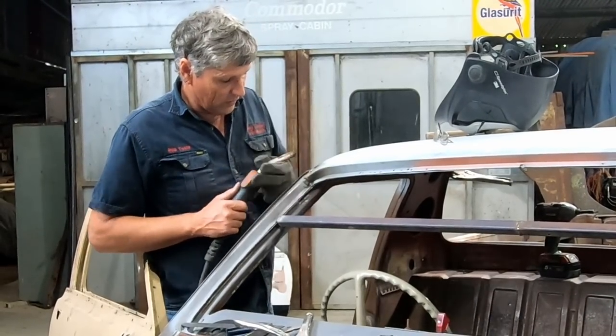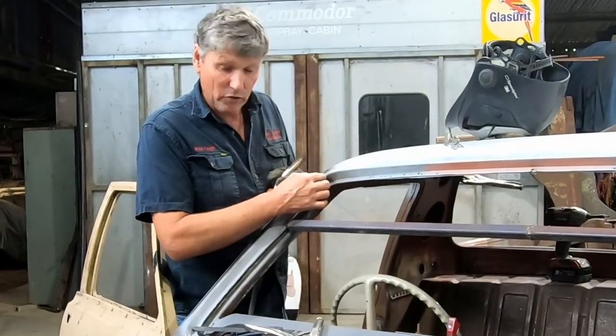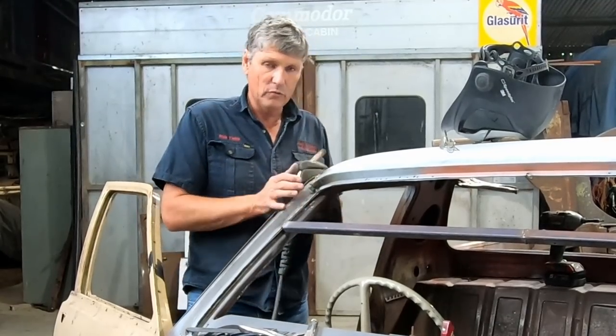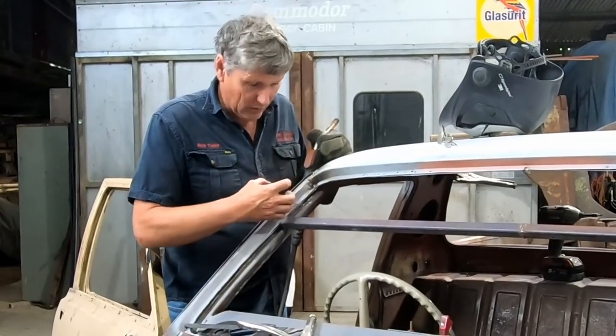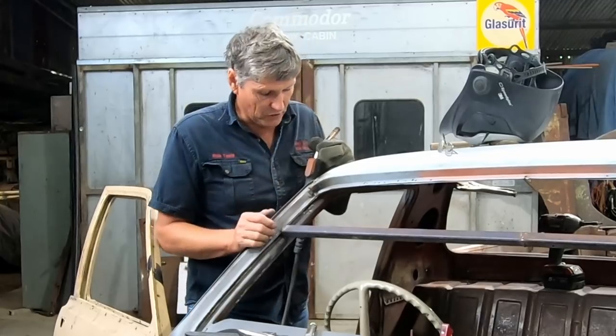And that's the trick. If you put this down and tried welding it as you would welding two little bits of thin metal together, you'd wind up with a cold weld because the thick piece would suck all the heat away from it. So pump the heat into the thick piece, let your weld flow on, and it'll melt onto your piece of steel and it'll attach it perfectly.